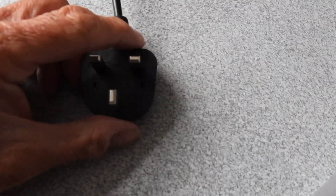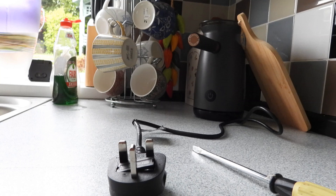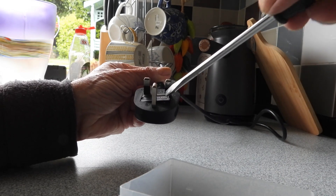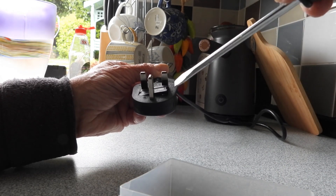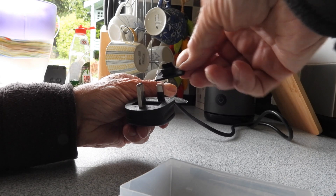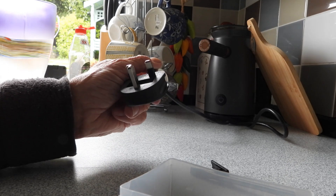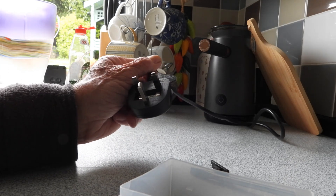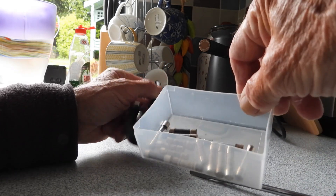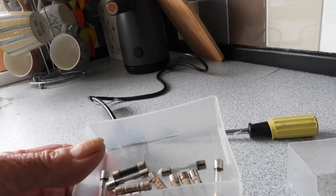This is the newer type, where you flick the fuse out — you put a little screwdriver in there and ping it out. So we just flick this piece out here; this one's along here. Some are in different places, but basically you get something sharp to lift up under there. Normally it should come out with the fuse. You can even test it with a test meter, which I'll show you in the second video, or you can just have a box of fuses and change it for one you know is not broken.